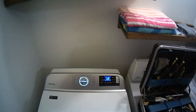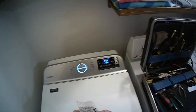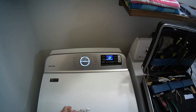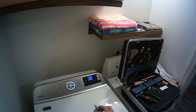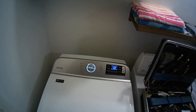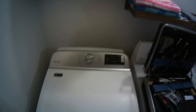We have everything working — all the lights are on, it's spinning really well, but no heat. So it's probably one of these two fuses: this thermal fuse or this high limit fuse. This one lives about right here behind this panel, and this one lives on the burner tube, about the same height but back a little further. We're going to be testing those next.